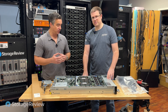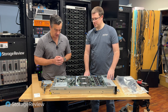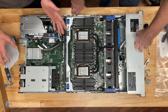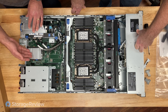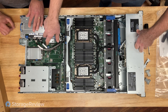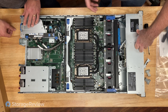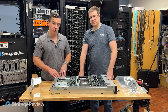We're super excited about the liquid loop, and I'm pretty curious to see what it looks like in ILO and potentially HPE InfoSight, just to understand the telemetry that comes off it. There are some fantastic onboard boot options — USB 3 slots on the board. There's also a blank here for another OCP slot. We've got a 10 gig NIC in the current OCP slot, and these are the PCIe headers for the second OCP slot, designed to keep the system flexible.